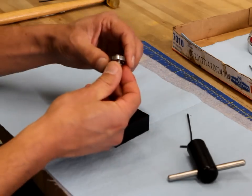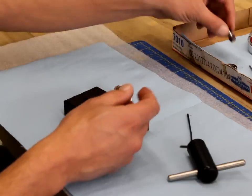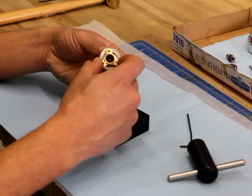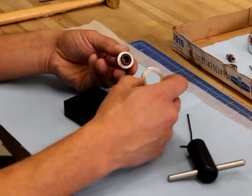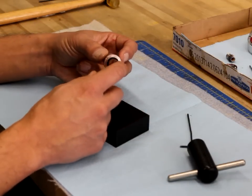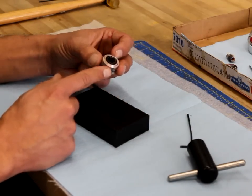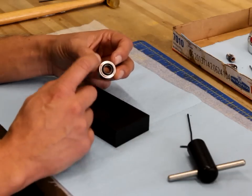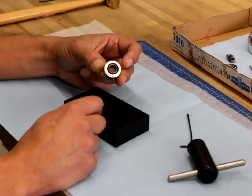There's my pinion gear and my main bearing — I'll put those aside for cleaning. I'm going to lift the shaft guide and the knurled locking knob out and put those aside, and that's going to leave me with the clutch housing and the main seal. This is the most important thing we need to service every year. This seal gets more wear than any other seal on the reel, so it's very important that we change it every year.